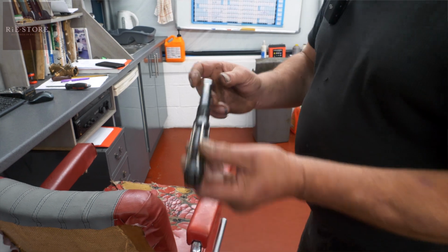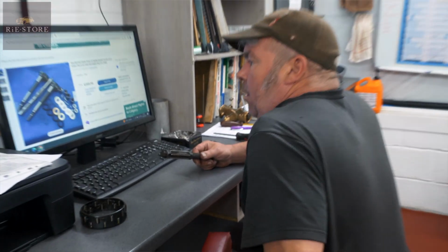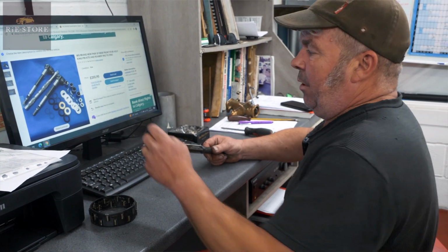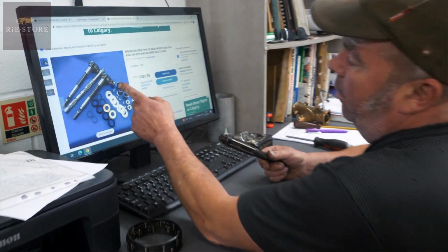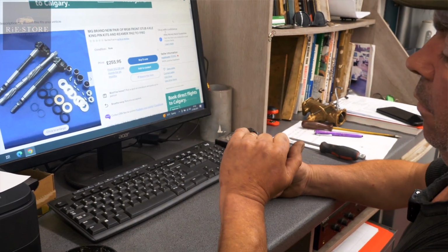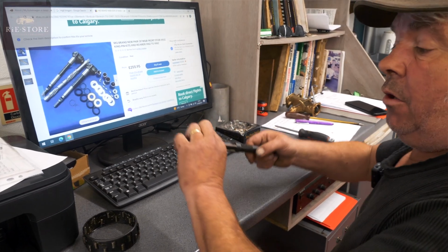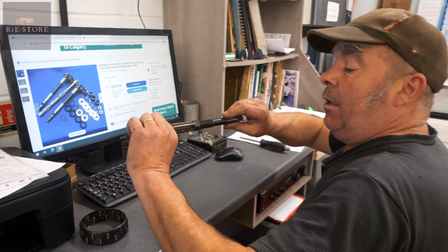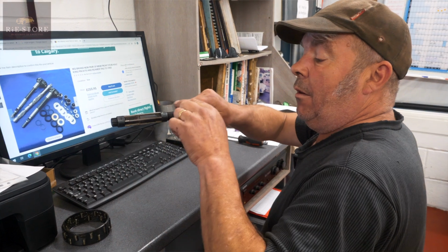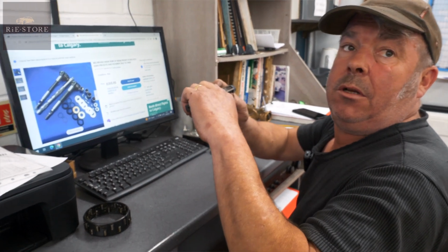Okay. So they're adjustable. It's very hard to explain, but if you made something that fits in the small bush end with a point on it, if you've got a lathe or anything, machine it up so it fits in the centre of there, then you know that when that is in there and you're reaming that hole, the big one, it'll be in line, and vice versa.